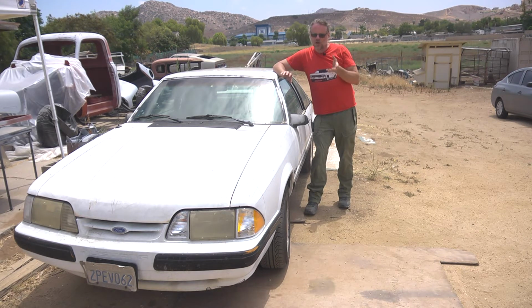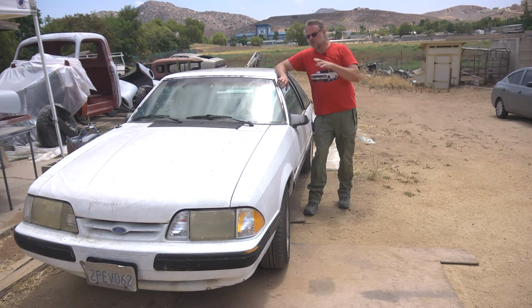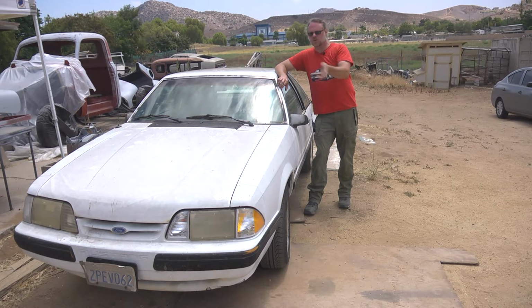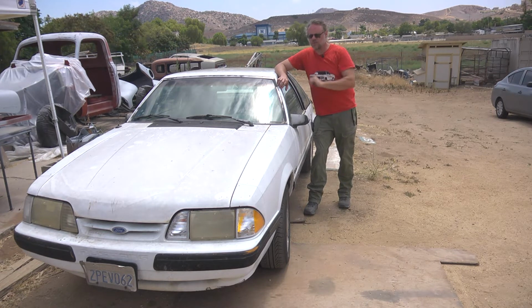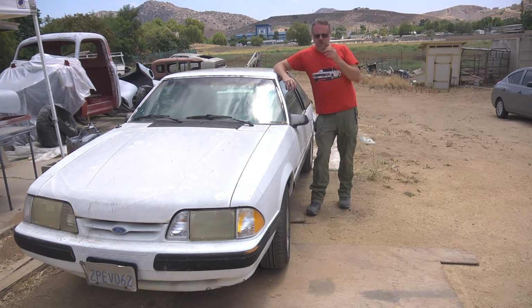Something that I'm a little surprised with, given my experience dealing with 10-year newer sequential multi-point fuel injected vehicles, where a lot of this stuff is handled quite readily by the electronics and the programming. This being a very early sequential multi-point fuel injected vehicle, there's a fair amount of mechanical adjustments built into it that are sometimes necessary to get into and adjust, and we will go through and talk about all that. That should establish a nice baseline so that we can go through and eliminate timing issues and so forth as a possibility for the reason why it sometimes wants to stall.